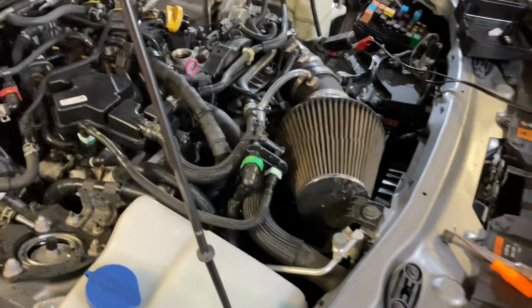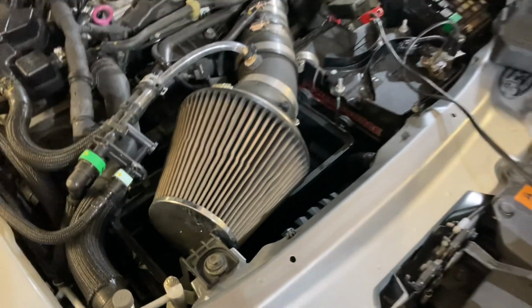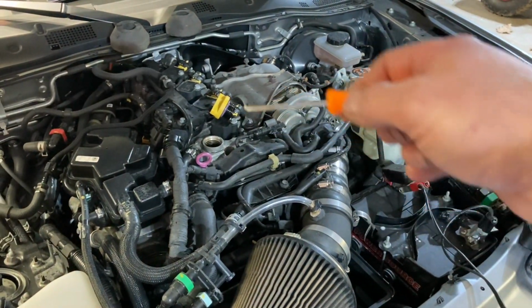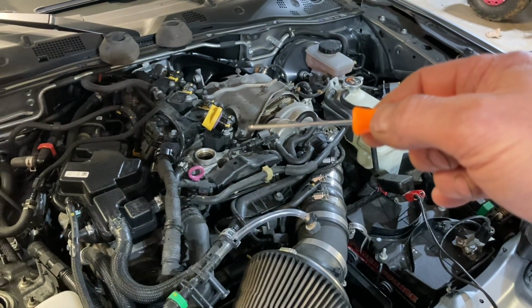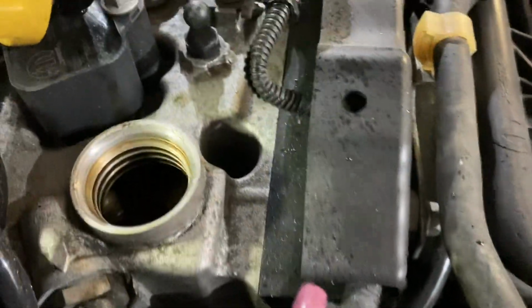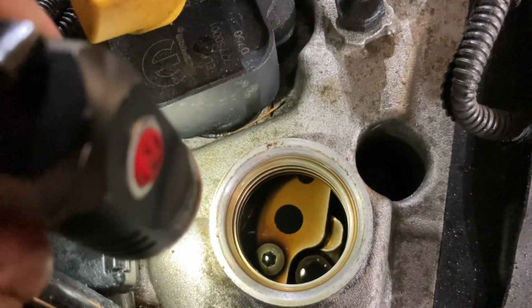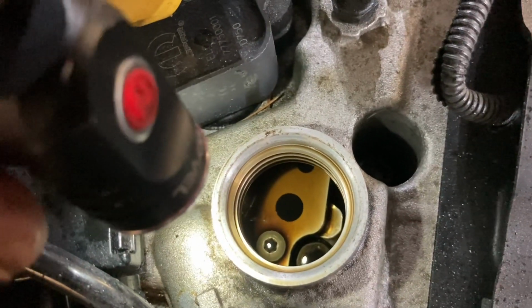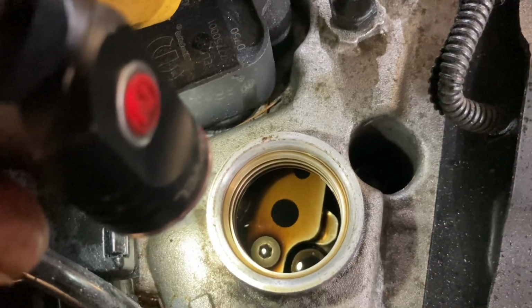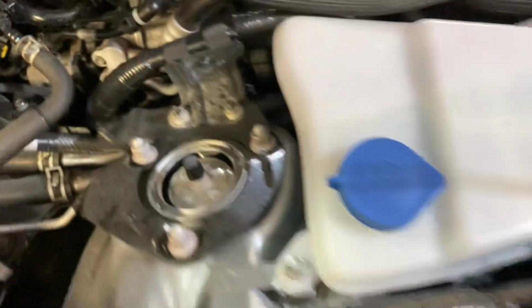Pull that out. Now, this is where I read a lot of threads and forums and all types of stuff, and I came across this. It's basically an oil block up on top. They call it a brick. So down inside here is a priming pin right down in here. So it's a ball. When I looked at this, it was completely dry, and you'll see a metal ball bearing sitting right there, dead smack in the middle. It's very small. It's not big.